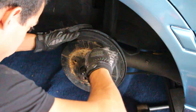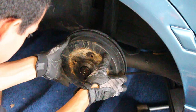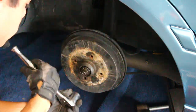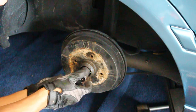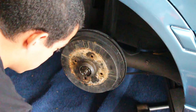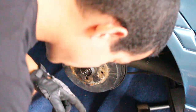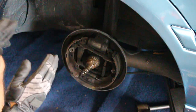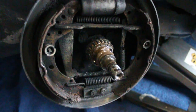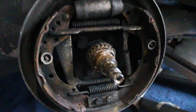Pin is out. Then there should be a little cap right here - it'll come off. Pull that out as well. After that's off there's a nut. Once the nut is off it should slide forward. I had my e-brake on - take your e-brake off, kids, don't do what I'm doing. I always forget to pull the e-brake off. E-brake's off, now it should slide straight off. There we go - that is now out. You're left with this here - you want to pull the back bearing off, and then there should be four 15mm bolts that go through. Undo those and we can slide the whole thing forward and off.